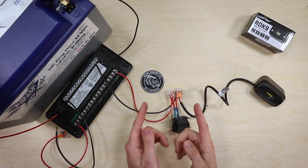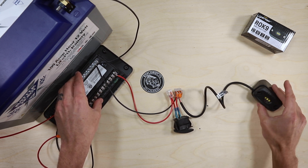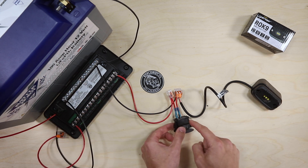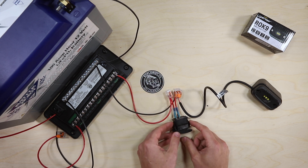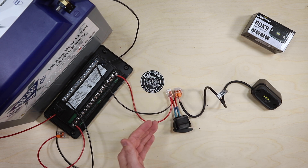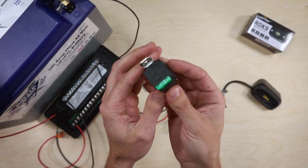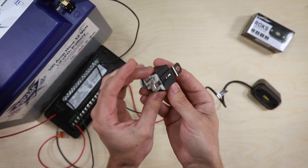But in the van, we're going to have our fuse block up top and our lighting up top, actually pretty close to the fuse block. But our switch is going to be up in the front cab area of the van. So that's why we want to introduce relays into this system. And that's pretty much what this tabletop demonstration is going to be about — teaching you how to wire a relay and what you would use them for.